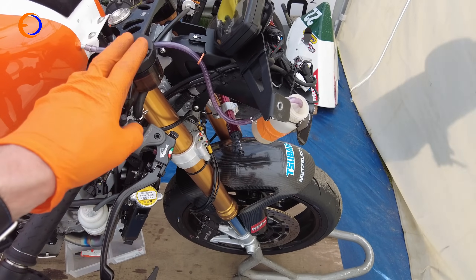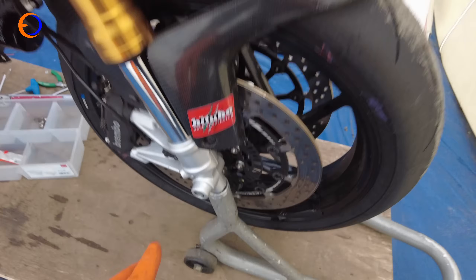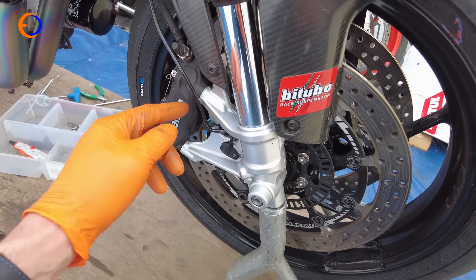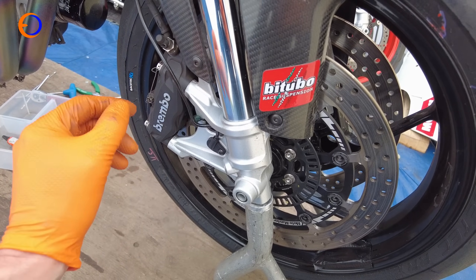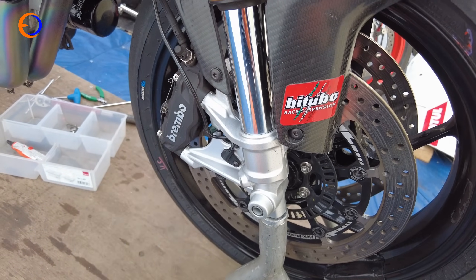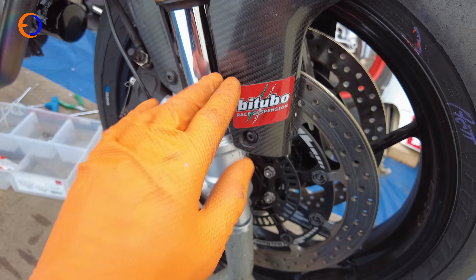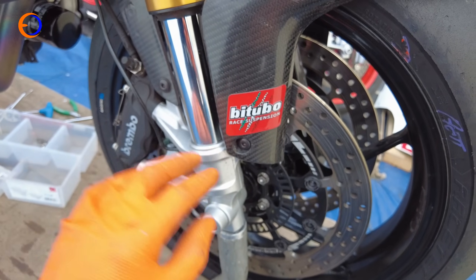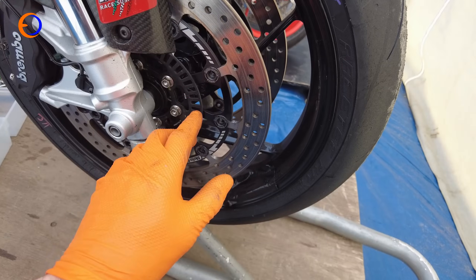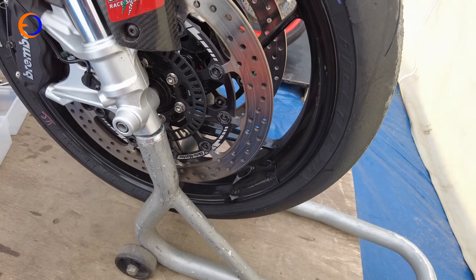Moving back to the front of the bike, the next thing is to bleed some fresh fluid into the brakes — I'll do the fronts first and then the rear brake as well. Once I'm happy they're all bled up, I'll strip the callipers off, give the pads a deglaze, get in with a toothbrush and some detergent, clean the pistons, make sure everything moves completely freely, and have a really good look around to make sure everything is happy with the brakes before putting them back together and re-lockwiring them. It's also a good time to wipe around the fork legs and check for damage — it's really easy to get a stone chip on the edge of a fork leg that could damage your seals during the race. Also give the brake discs a wipe, make sure the floating elements still float, and check for any damage.